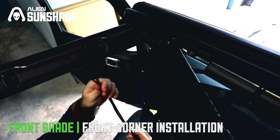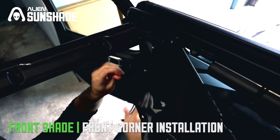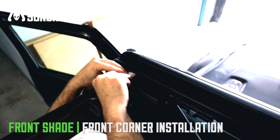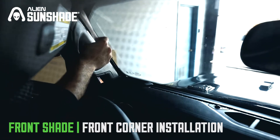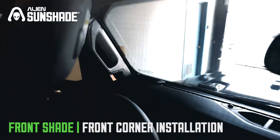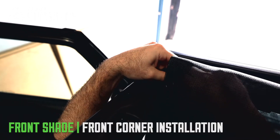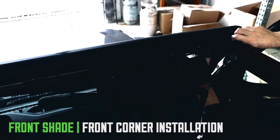Once we're done with the other side, we're going to move to the left corner. Grab your longest t-bar bungee and slide it through with the t-bar on the bottom. Once it's through, use your installation tool to wrap it around, sliding it through right above the windshield in the corner on a 45-degree angle. Give it a good push and the tool will pop through on the other side — that allows you to grab the bungee and wrap it around the t-bar. Note that the first time you install these bungees they're a little tight; they're built for durability, but the more you install them, the easier it becomes. Once secured, repeat the same thing for the other side.